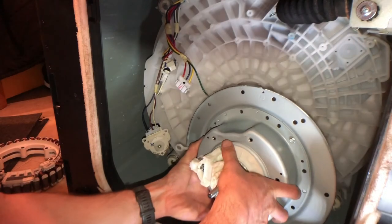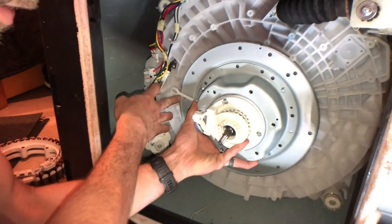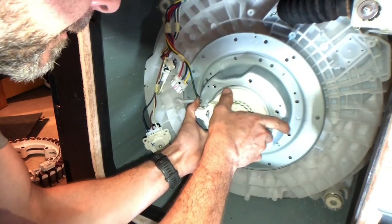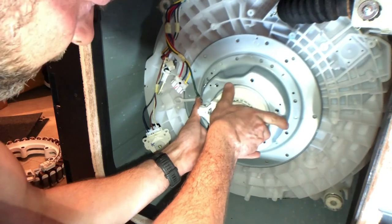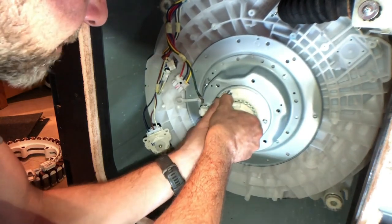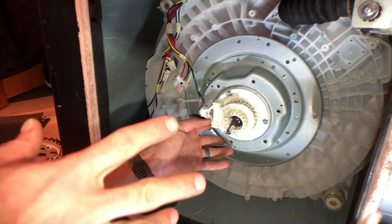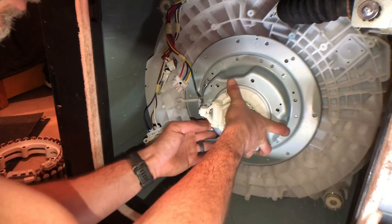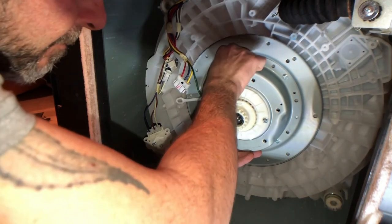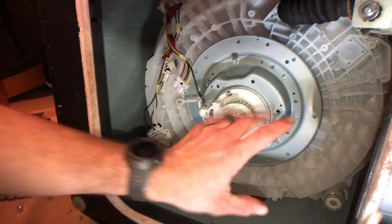Do make sure you watch your orientation. Your actuator was over here and there is a little plastic dowel. If you're in the wrong orientation, you could end up turning it too much. It was supposed to be at the nine o'clock position if you have it on the front. If you lay it down on the back it'd be in the three o'clock position.